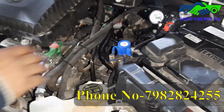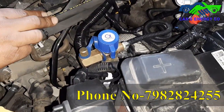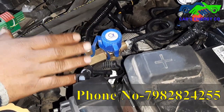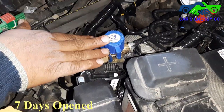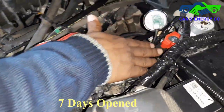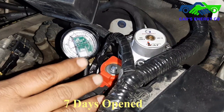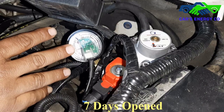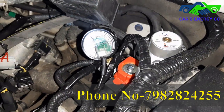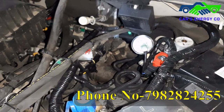This is the filling valve — here the gas is filled directly on the cylinder. This is a non-returnable valve, called a one-way valve. Gas fills into the cylinder and will not come back. This is a double stage reducer — Gas Tech Italy, a heavy-duty kit. This is the meter which tells you exactly how much gas is remaining: full, 4, 3, 2, 1, reserve.